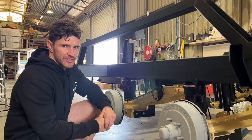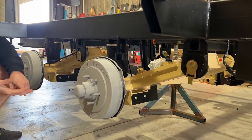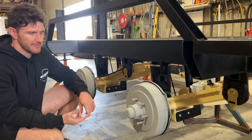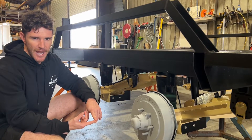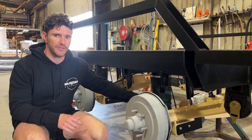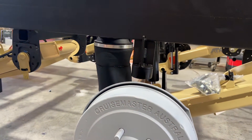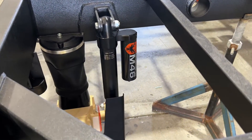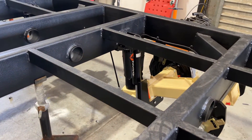A lot of the new chassis is centered around running CruiseMasters ATX suspension system. There are a couple of variances with the ATX system over the XT. The main predominant differences are a different arm design, a different cam lock design for adjusting your camber and toe. A couple of the most obvious differences are the different style of sleeve-over-airbag system, more commonly associated with a truck-style airbag. And lastly, the biggest difference is the shock absorbers themselves — they're M46 remote reservoir shock absorbers, so you've got the adjustability to do rebound and compression dampening adjustments.